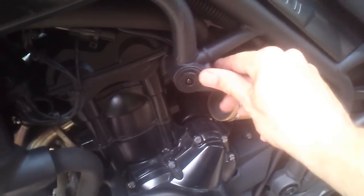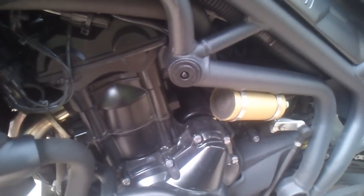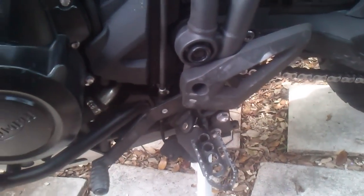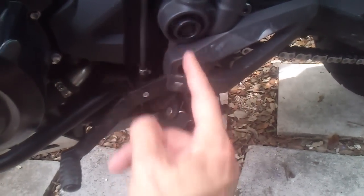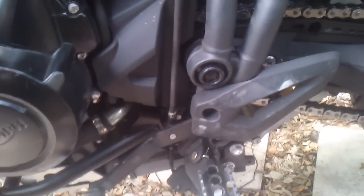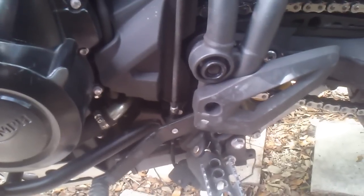One other thing — you can get from Triumph these actual covers for the frame, but I actually found a rubber bushing and cut down the inside of it so it would fit the hole. Inside there, believe it or not, is a valve cap for the tire — looks quite good on both sides and cost me six bucks. Down here for this large one, this is actually a small gasket for a brake reservoir, which fit perfectly in there and covers that main nut on the frame.